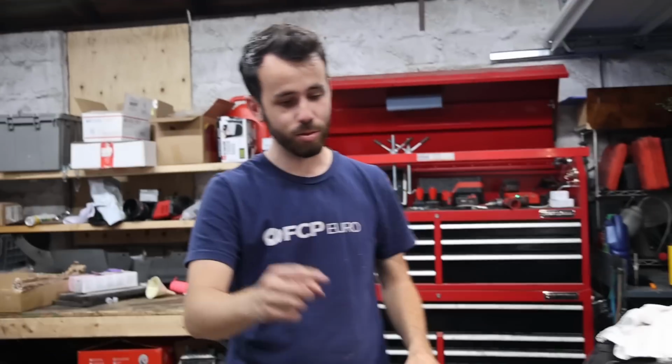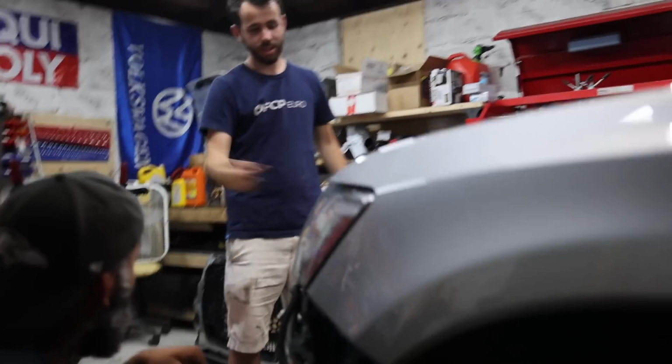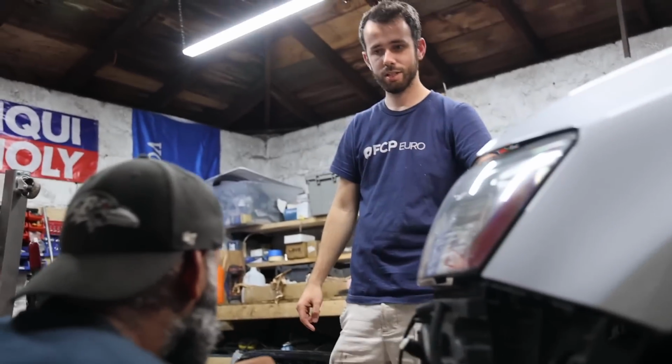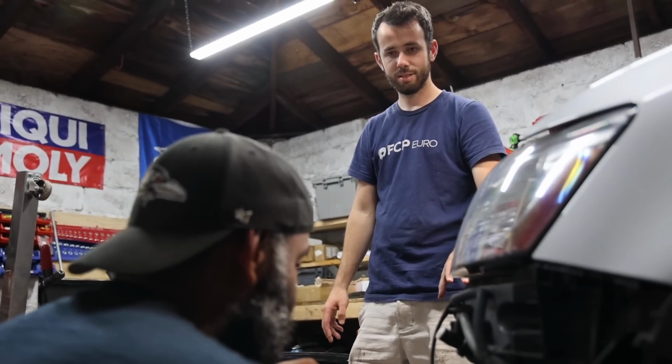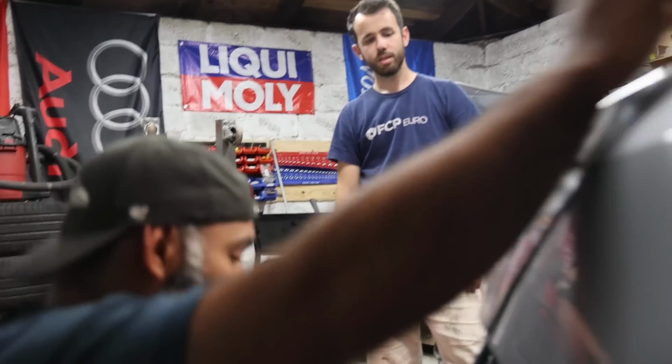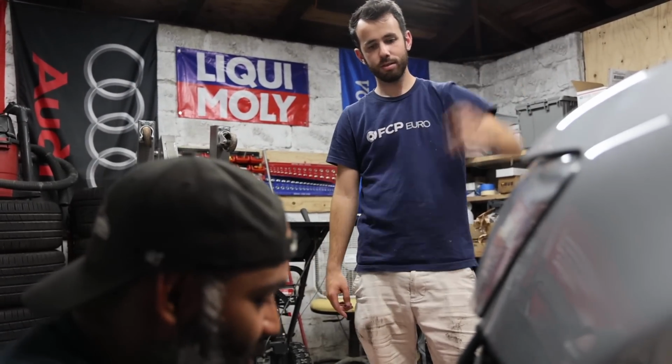Let's do the bottom one first and let it push. This is totally theory, so I want to hear your thoughts too. My theory is do the bottom one first and let it push the air this way into here where we have the bleeder. Yep. So if we do the top one first, it's going to suck it that way. That's true. That's my guess. I don't know how founded that is. Because the top one is connected to the... Right. Yeah. So I think we do the bottom one, let it push the air up to here, and then do the top one and send it out.